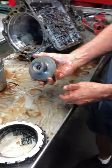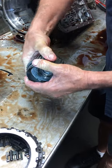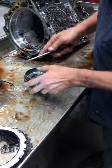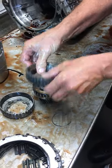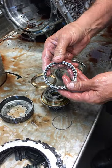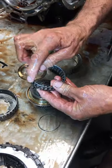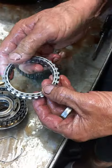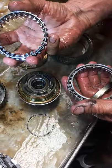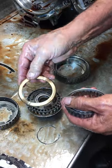Let's get into the sprag right here too. This is called a one-way clutch — it turns this way and will not spin backwards. GM's made multiple upgrades to this as the transmission has been changing form through the years. This is their design sprag. The early design was a roller sprag — this is ours, it's a single cage. The one we go back with is a dual cage that supports it on both sides and makes the bearing so much stronger. We don't put the single cage in any application; we upgrade to the dual cage no matter what. But this is another weak link in this transmission.